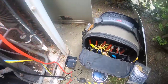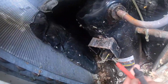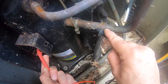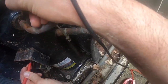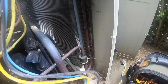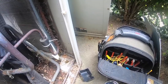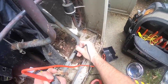A little moisture in here. Let's test this compressor out. This is my first attempt at using the GoPro. My windings should not have resistance to ground — they should be well insulated. It should be open line, no damage to the insulation, open line like it's supposed to be, because we don't want to be grounding our power.